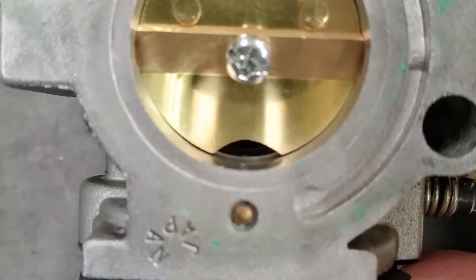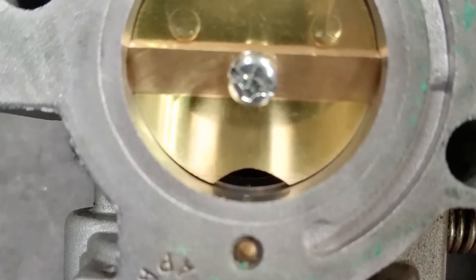What I've managed to do is effectively change the fuel-air mixture throughout the range of the carburettor. There was a way we fixed it before — closing the low jet — but that made it an absolute pain to start. Look on screen now and you'll see a picture of what I've had to do to my carburettor butterfly valve, or throttle valve — the brass disc. I have taken out a large chunk to allow more air. When that disc now fully shuts, how many people have had their idle adjustment screw hard-stopped all the way in trying to get the engine to idle?